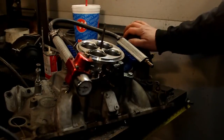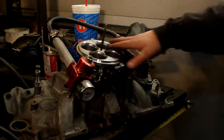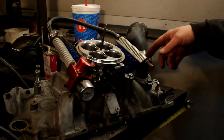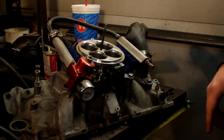This is the intake that was on the car. It's one of my first throttle bodies with eight injectors, making it a throttle body injection setup. I want to convert it to multiport because I just haven't had time or money to test this setup, and I know multiport works.